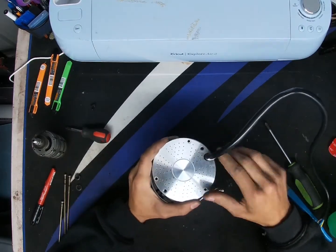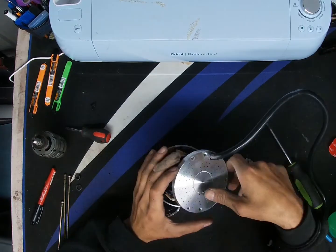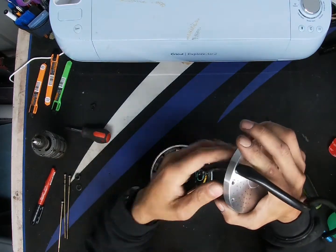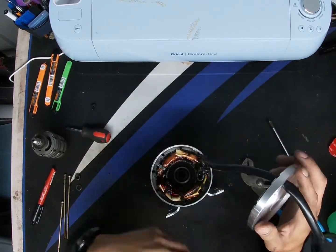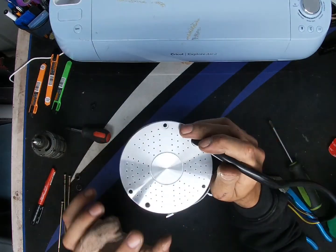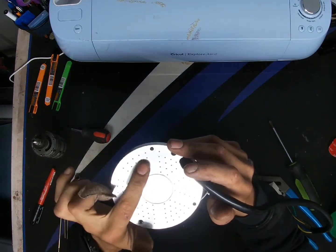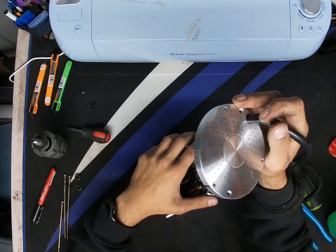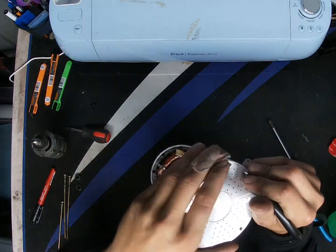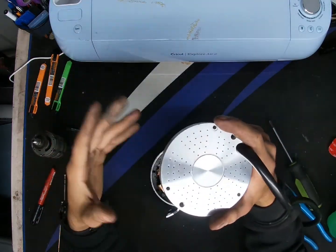If I probably would have had the vent ports drilled out, I wouldn't be going through this issue. So usually what people do is, I'm not sure actually, I don't know if people do this, but the way I'm gonna start doing it, because all the new motors I'm getting, which I just ordered, I think I ordered like three or four, I'm gonna go ahead and drill all these out. So I will disassemble the motor. That's why I said to leave a black mark, so you guys can identify and make sure to put the casing back together in the exact order you disassembled it.